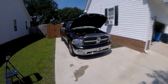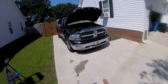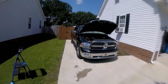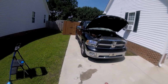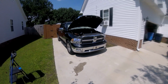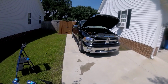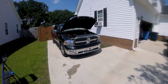Again, my name is Chris, the DIY technician. I'm no professional mechanic. However, something like this may seem daunting, but honestly, the job wasn't too bad. All you need is an 8mm socket with a 1/4-inch ratchet. A T25 bit is what I used. I had a drill to make the job a little bit faster, and a flathead screwdriver. You don't need crazy tools to get this done, but if you have drills and things like that, it'll speed the process up for sure. Other than that, that's the process.